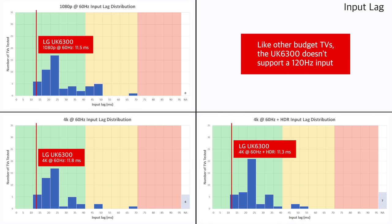The response time of the UK6300 is fast, so only a short blur trail can be seen behind fast moving content. This is good for watching fast moving content such as sports or gaming. Duplications of our logo are visible due to the flicker of the backlight. The UK6300 has an extraordinarily low input lag, so it feels very responsive when gaming or used as a PC monitor. At about 11.5 milliseconds, this is the lowest 60Hz input lag of any TV we've tested. We can see how it compares to the competition by looking at a distribution of the input lag results on our current test bench.